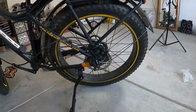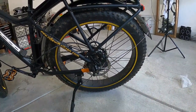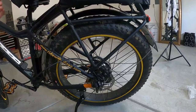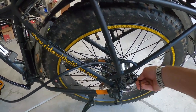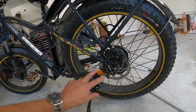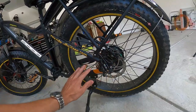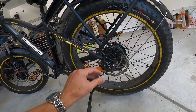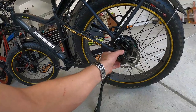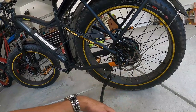To get the caliper set in the right spot, I usually pull the brake, squeeze the pads onto the disc, then tighten everything up while it's in that position. When you release, the pad should back off appropriately. It's done - it's on there. We've got hydraulic brakes now. Two bolts to mount the caliper and two bolts for the lever and you're done. They are on there, they are functioning and working. The lever feels a little spongy, I wish it was a little firmer, but it does work. I have hydraulic brakes now.